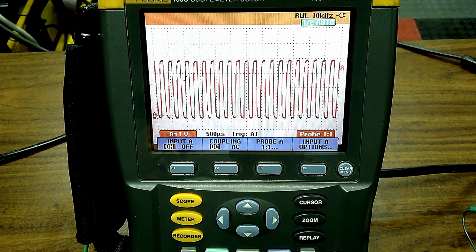Let's see if anyone comes up with anything else. Time base, MAF? What sensor are you controlling, inputting? This sensor I'm controlling is the mass airflow sensor digitally. So fuel trim will change. What else may change? Injector on time. Good. Okay, so injector on time.